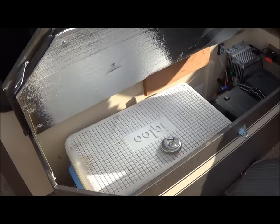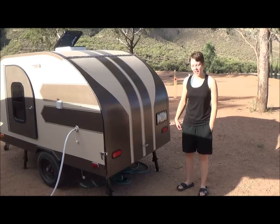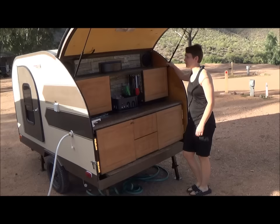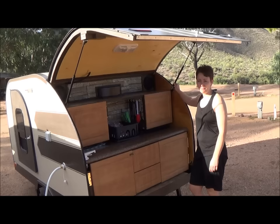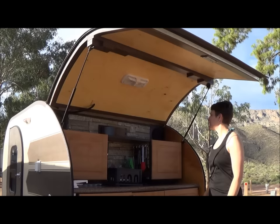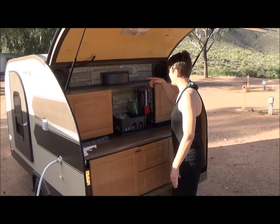Let's go around to the back hatch. The gas struts were one of the biggest pain in the butt because I had no idea what weight or length to go with. I tried several different configurations and settled on 26 inches, 75 pounds for both, which worked well. In order to get it high enough up with this much of a bend in the hatch, I had to build out here. That was definitely a very, very frustrating part.